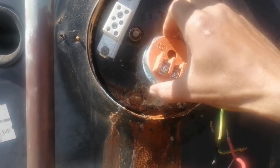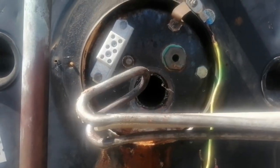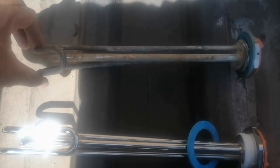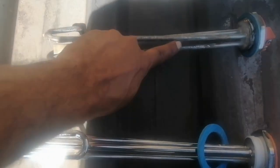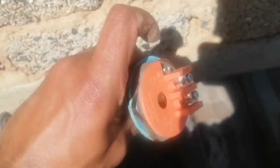I've opened it up and it just comes out like this. Take it out — and there you go, the old one is out. Let me compare this to the new one. This is the old element compared to a new element you would buy, and there is evidence of it being burnt, especially right over there and in the corner as well. The water will go through these tubes and out and then leak onto the terminals — you can see there are kind of holes there on the inside.